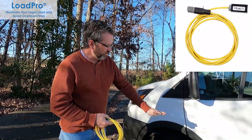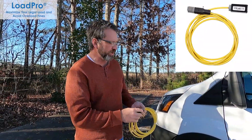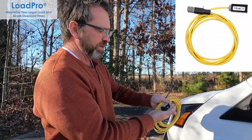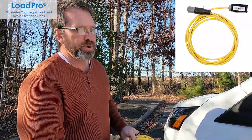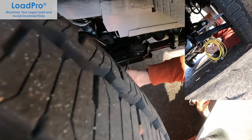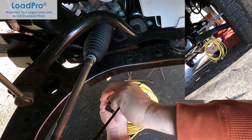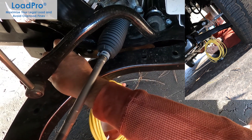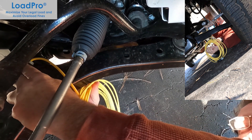For the front, we don't have a traditional leaf spring like in the rear. We've got a side torque arm or stabilizer arm coming into the wheel. So instead of mounting it the way we did in the rear, we're going to mount our inclinometer on that side arm coming into the wheel. As the suspension raises and lowers based on the weight, we pick up the angle that way. We take a little bit of paint off to get a good surface, get our sensor up there, clamp it, wrap it, and let it cure.